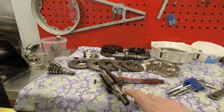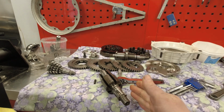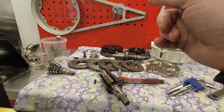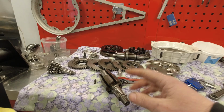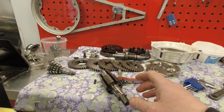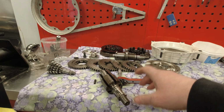Yeah, so go with the recommendations. What I recommend basically is if you buy an MB gearbox, then fit an MB bearing and an MB lay shaft, because that way, if you get problems, you can phone up MB and say, "Hey, I've got problems," and they'd probably be able to give you some help with that, without fobbing off other people's products.